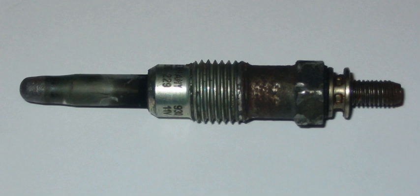Pre-chambered engines use small electric heaters — glow plugs — inside the pre-chambers. Direct injected engines have these glow plugs in the combustion chamber. The glow plug is a pencil-shaped piece of metal with a heating element at the tip. This heating element, when electrified, heats due to its electrical resistance and begins to emit light in the visible spectrum, hence the term glow plug.